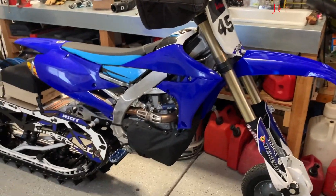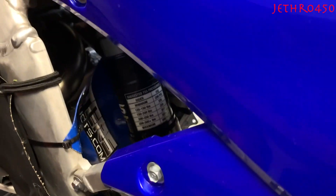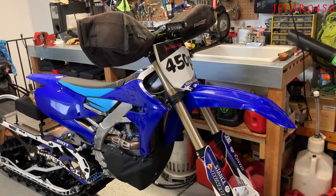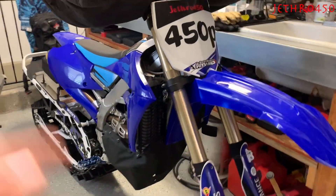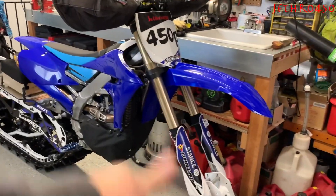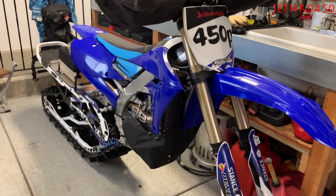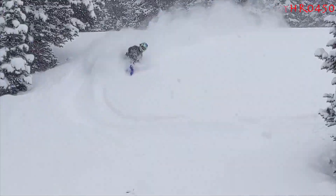I did end up putting a motor blocker in there to keep snow off the back of the motor, and I feel really good about that for temperatures in deep powder. These radiator guards are actually more open than your standard plastic ones, so when I pull the blockers out on roads — where my bike would always heat up before — it doesn't heat up at all anymore. Without my radiator blockers in, the bike stays around 160 to 170°F on the roads, which is perfect.